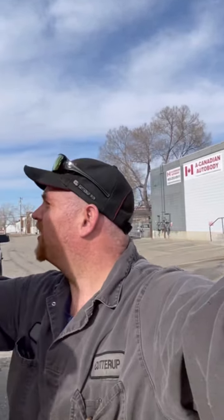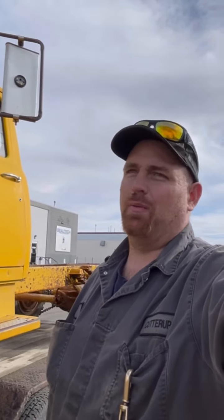It was a city truck because it says Red Deer right on the side — I don't know what it had for a box. It'll have air ride front and rear eventually — the big axles. I'd like to see about using F650 axles out of like a 2005 and newer, so it'll be big diffs, but I want ones with the lower gear ratio — I think you can get a 3.90. I want juice brakes and disc brakes, so I don't know if I'll end up with those axles or something different — maybe something out of an International or a Freightliner. We'll figure that out when we get there.